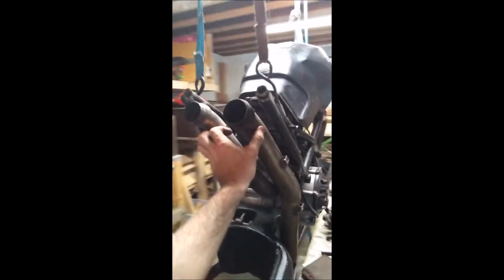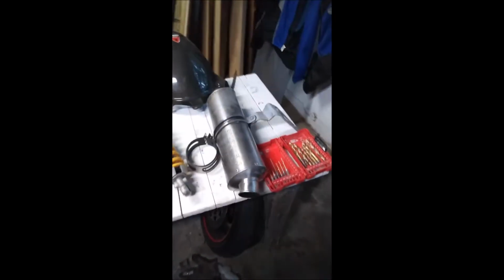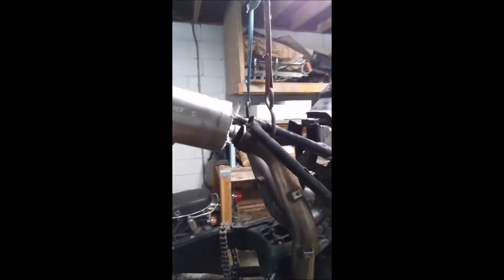We're going to turn it to square tubing going back, and we're going to take the bike up and straight back a little bit more. Here are the exhaust pipes we just kind of mocked up for now. We chopped some mufflers down. They're Remus titanium ones that were on my Monster, but they're big bore and those fit just fine. Cut them in half. We are going to chop this baffle, slip that back inside, and then the muffler will mount up under the seat just like that.